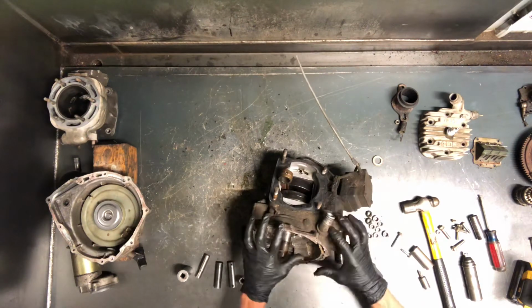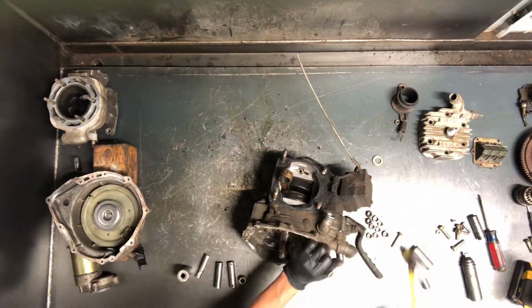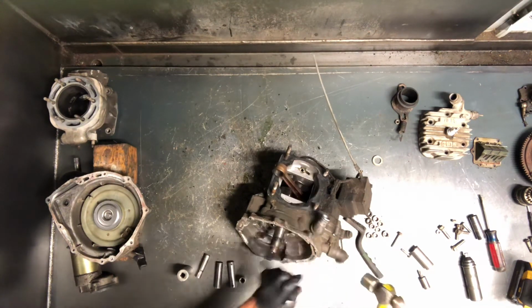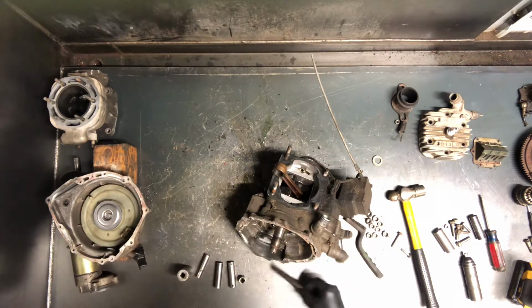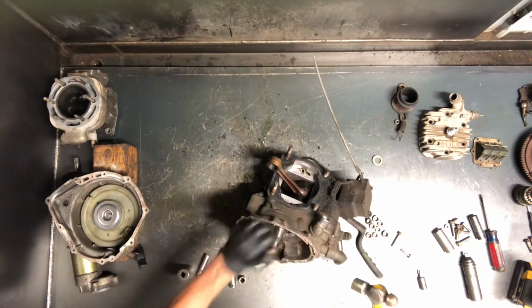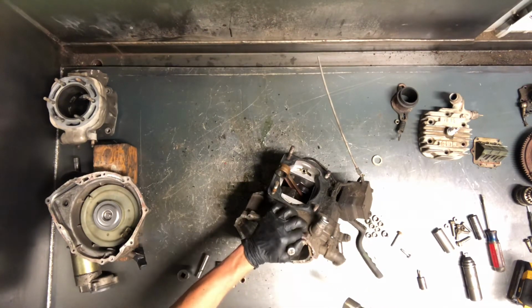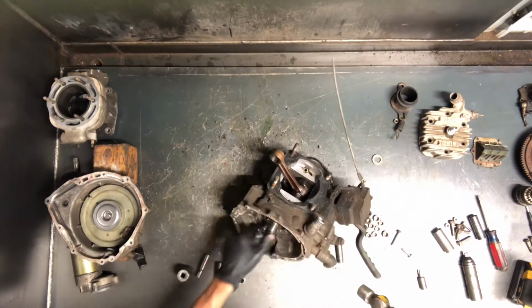So this is a plate here that comes off. This isn't even your crankcase. So we'll grab a chisel then, and loosen this up. And make sure that when you're doing it, the crank's gonna turn. A lot of times what I'll do is grab a Sharpie marker and mark the crankshaft and that nut to make sure I'm turning. If we're having problems with it turning, we've got to stick something in that crank so that it keeps from spinning, but it's loosening now. If we had something holding that crank, then we would have been loose by now.